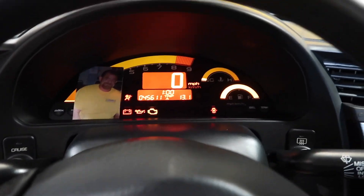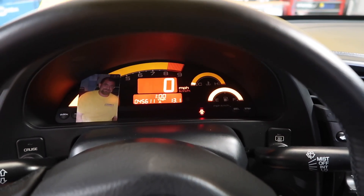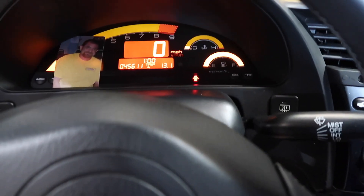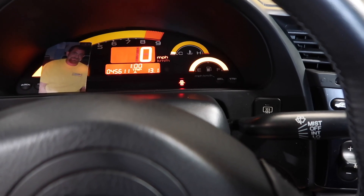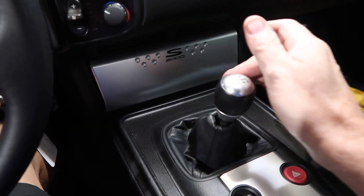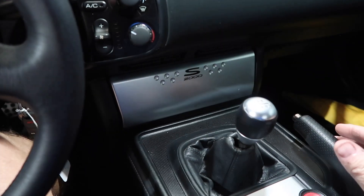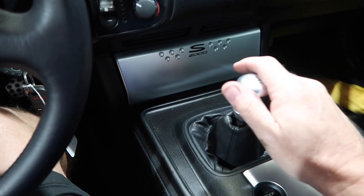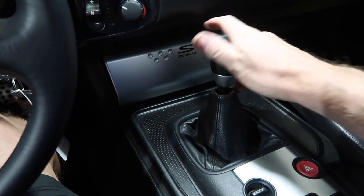This is something that is really, really OCD — if you want to break in your clutch with no weight on the wheels. This is something I do. I usually put like half a mile on this before the car even leaves the shop, even if the customer doesn't know I do it. I just want to give the clutch the very easiest start in life.